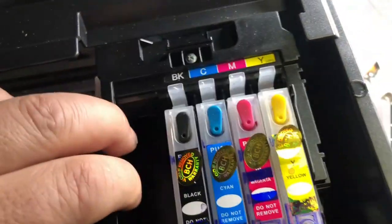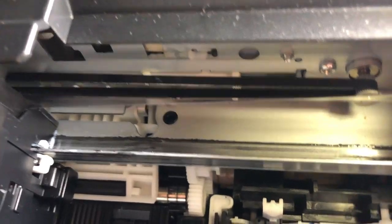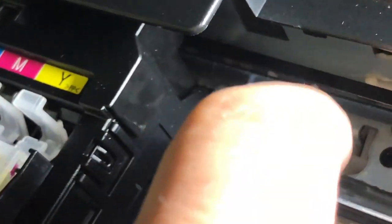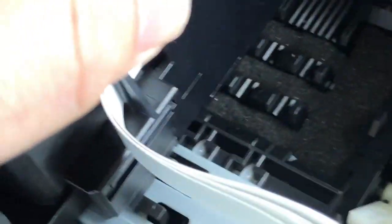Here's the clear belt. You're going to find that the carriage is hard to move. Can you see the belt is twisted? If you see the opening right here, most of the time the belt is caught right there. Just use your finger, push it back, and give a little tap. Now you can see the belt is vertical, and it's very easy to move the printer around.